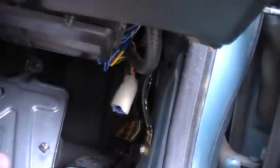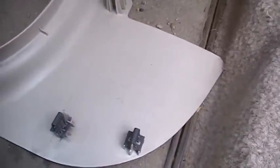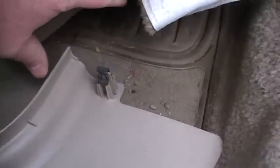And this piece was right up in here. Kind of sat under there. Sorry about that. Kind of give you an idea. It serves like that. It's got clips on it, and you want to make sure these clips come all the way out. See, there's a slot where one went in. So you just put your hand there and pop them out. And then there's one back there, and there's probably one up top. You want to make sure you get your clips out when you pull that out, because sometimes they'll stick in there. And then also, I like to put silicone spray on them, and that helps them seat back in and makes it a little bit easier next time you have to pull that out.